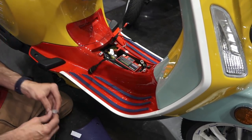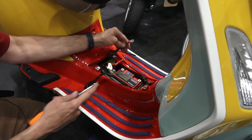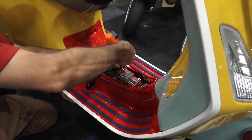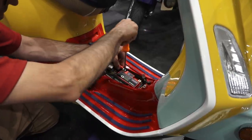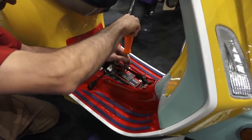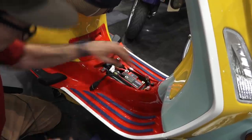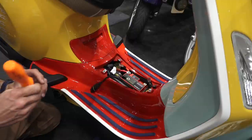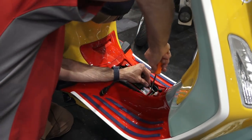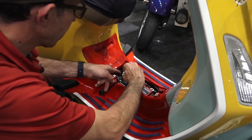Go ahead and pull the terminals off. Same steps here — put the square or rectangular nuts underneath the two terminals and start with your positive terminal. If you have battery tender-style pigtail leads, put the battery pigtail ring terminal on top, then the main terminal to the battery on the bottom. The nut can want to kick out a little bit if the scooter is tipped. Then do the same with the negative terminal, and tighten the screw down. Make sure the lead is out of the way of the two areas where the strap goes.